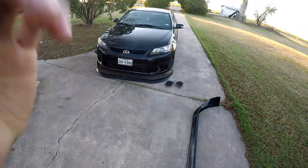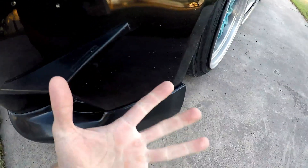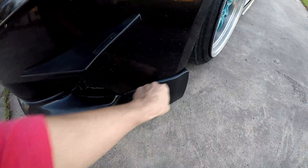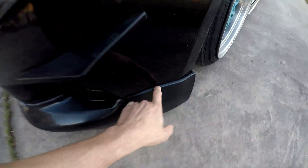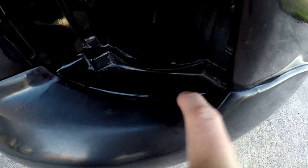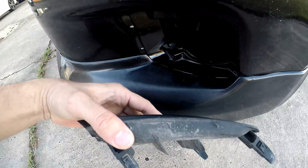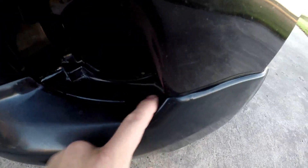Let me put it on so you can see where it's sitting and why I need to make the cuts. I've heated this up and with gloves — because the polyurethane gets a little hot — I used my knuckles and the corner of my hand to push, so you see how it's giving it a real tight fit. That's exactly what I wanted. You can see the line of where the cover fits, and once it's in there it won't sit flush because of that part, so I'll have to trim some away.